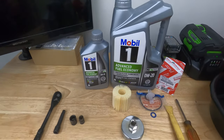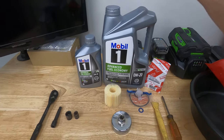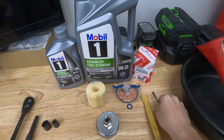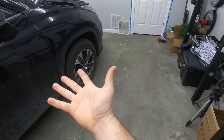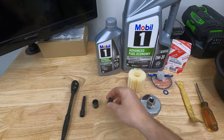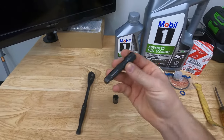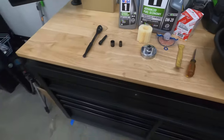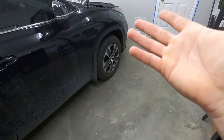The oil we're going to be using today — I'm a big fan of Mobil One. We've always used Mobil One on our Toyotas, and when I worked at Toyota a couple years ago they would use Mobil One there. You'll also need either a flathead screwdriver or plastic interior trim tools, because we have to take off the shield underneath the front. It'll have some plastic push pins. You'll use a 10 millimeter — there are two 10 millimeter bolts underneath — and then a 14 millimeter for your oil drain plug. You might want an extension because the 10 millimeters are kind of up in that bottom cover. So let's get underneath the car. You will need a drain pan too. We'll jack up the car to give us room to get underneath.